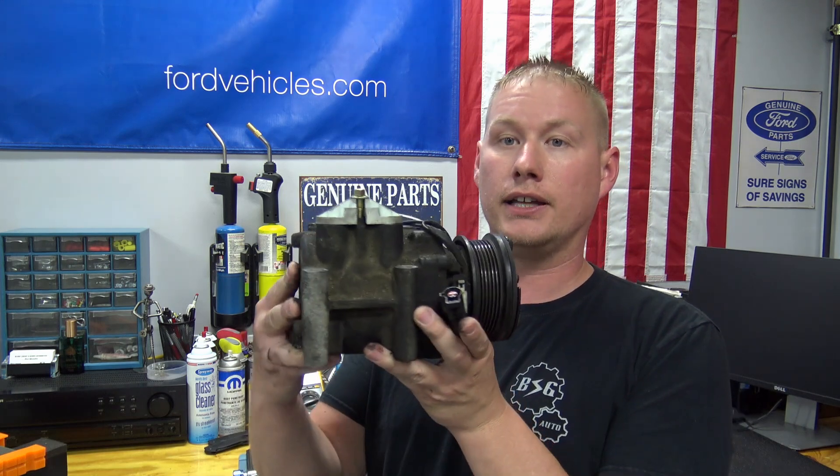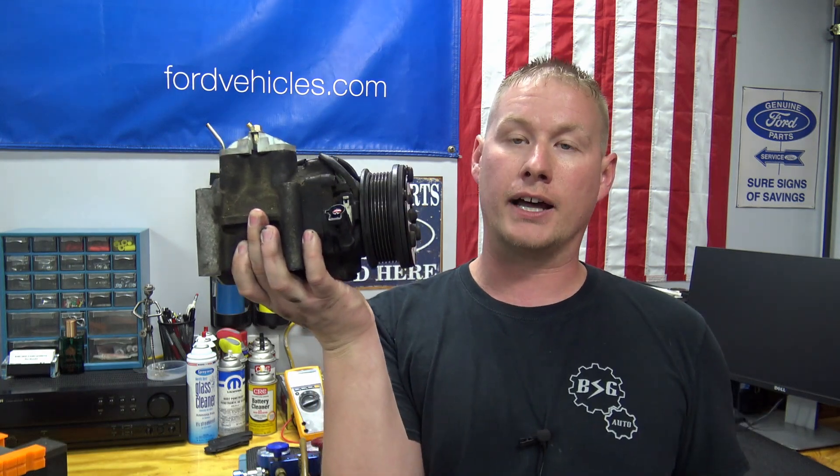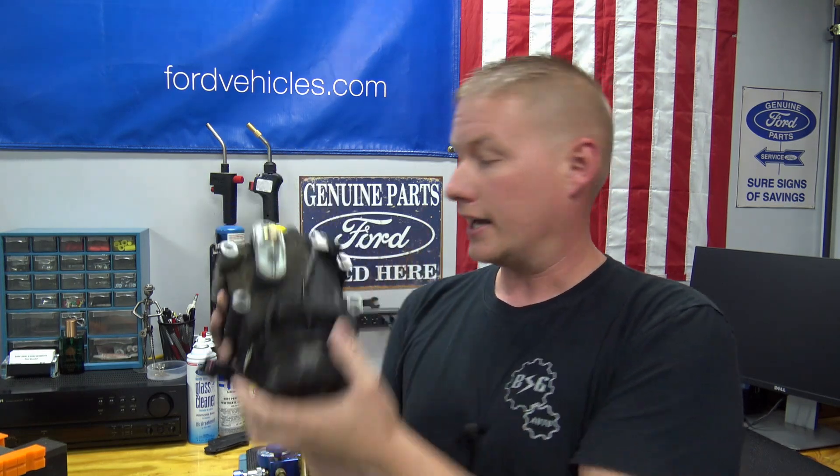The next thing is you want to make sure your AC compressor is actually turning on. The AC compressor has a pulley that's basically an idler — it goes with the belt at all times. What you're looking for is the hub face, the clutch itself, to be spinning while the engine is running. That lets you know the AC compressor is actually being commanded on, and at that point you need to bust out your manifold gauge set and start doing some diagnostics.